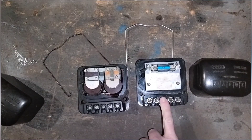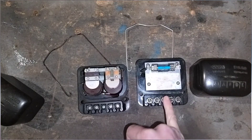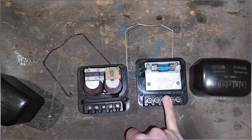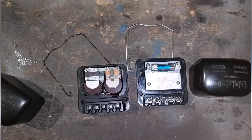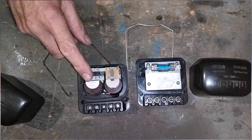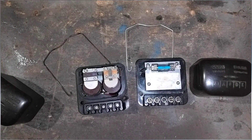This is a 12-volt positive-earth 22-amp control box. You can also get negative-earth ones and a six-volt version as well. The other downside to these solid-state units is they are much more expensive — around 150 to 160 quid. The reason the price is justified is that it's quite a complicated piece of kit. The cheap reproduction ones really shouldn't be 50 quid — it just shows how poorly made they are. They do fail regularly; the old Lucas ones did too, but the new cheap reproductions are much worse, as we found out.